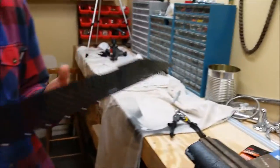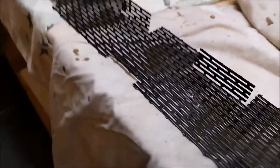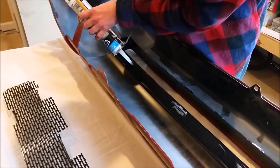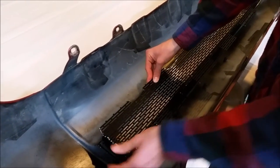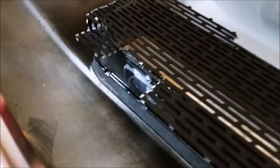There we go — needed to re-bend — and now we'll do the same process for this whole side. Here's the final piece after all the bends and cuts. To start off I'm actually going to put a layer of caulking along the plastic, and then once the mesh is on I'll do another bead of caulk on top of the mesh — that way it kind of sandwiches the mesh in between. This just nicely slides right on. Since there's a gap between the plastic and the mesh, we're going to be leveling it on this side. The mesh will not touch the rim of the plastic here, but it will still be adhered with these pieces that are bent. Now everything is nice and caulked, and we'll just let that dry — then this is ready to go back on the truck.